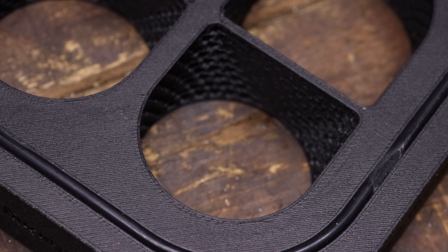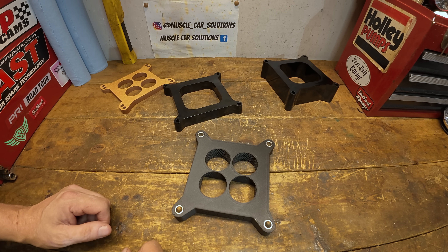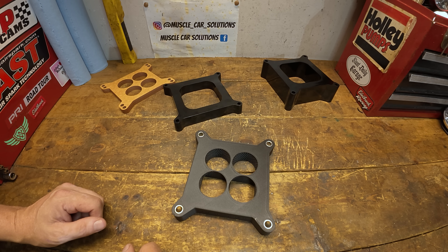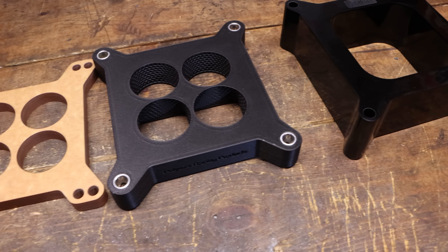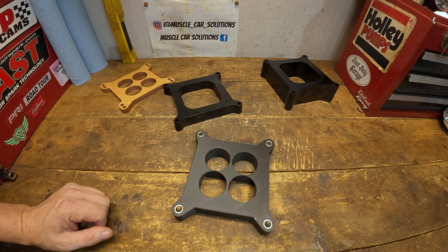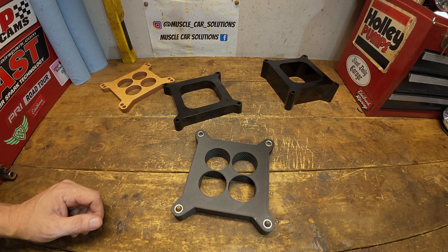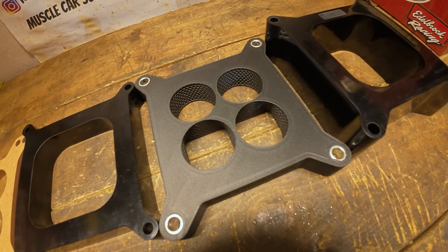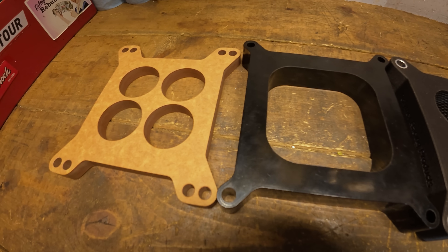The results are going to be very minute, I think — and that's the problem. If we were measuring EGT with O2 sensors in every exhaust port, we could really examine it, but that's sophistication I don't have and I'm not going to put the engine on an engine dyno for this. It'll be a little difficult, but I think we will see something. Now that we've got that sorted out and know how we're going to test, we have a baseline to work with. Let's get out to the truck, and then we'll start making changes in that order.